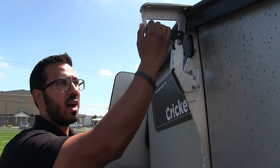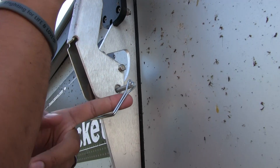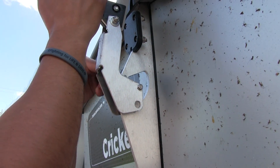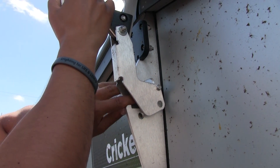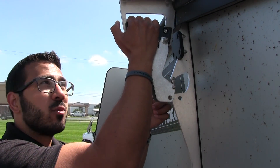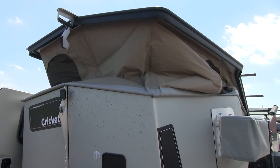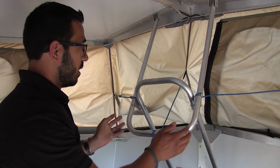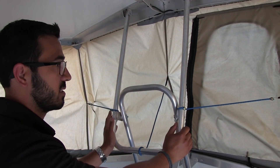The next step is right outside on the front — they have a nice built-in handle. Slightly pull down on that because the pin will have a little pressure on it. First remove the pin, then reach in and push the aluminum part forward toward the camper. There's a spring-loaded catch you have to push up, which will allow you to pull this aluminum part back. Once that is released, you simply let it rise up.